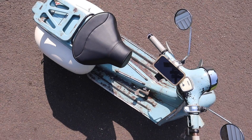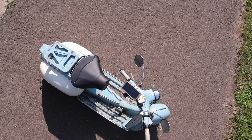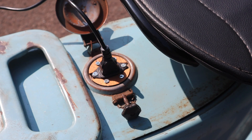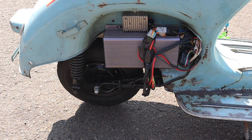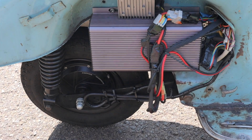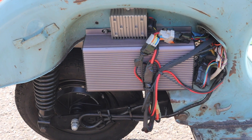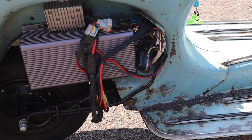For the specs, I have a 72-volt battery that is in the part of the bike where the gas can used to be. And I put — where the gas filler would go — I created just this little plate out of a piece of closet door, my favorite material to work with, to hold the plug. I have a 3,000-watt hub motor with a 72-volt controller on it, as well as a 12-volt step-down. All of my lights and smaller stuff run off the 12-volt step-down, and the motor runs off the 72-volt compartment. They're all easily accessible under this engine cover.